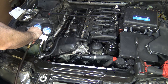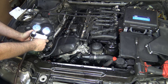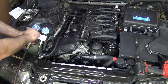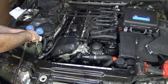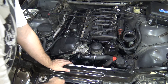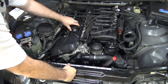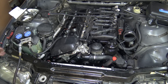I'm going to open this up and put air in there. If the gauge didn't go up, all the air would be escaping from the cylinder — probably through the exhaust valves because we'd be on the exhaust stroke and not the compression stroke. Since there are no losses right now, we know we're on the compression stroke. I also bumped my air pressure up to over 100 psi so we can at least get 100 psi here. One thing I also did was remove the air intake box so you can hear if there's air escaping from the intake manifold. And lastly, we're going to pull off the oil filler cap so we can tell if there's air escaping past the piston rings.